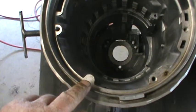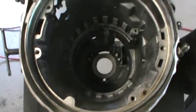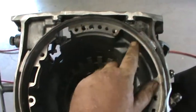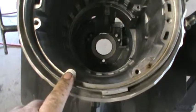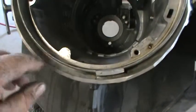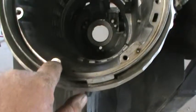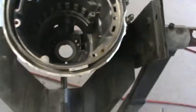You're going to put that big heavy bell housing on there. But you can tap this boss and put another bolt there, and then you go 7 bolts. This one doesn't do much because there's two there doing your oil ports. This third one isn't going to do a whole lot. This one's going to do a whole bunch. Most of them have this boss here — sometimes these are tapped even without having this. The Chevy cases were all over the place.